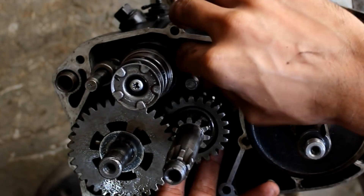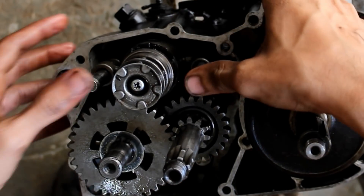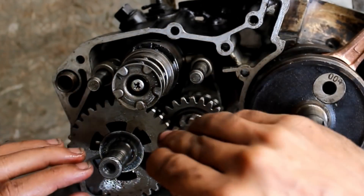To assemble the cam, you have to remove the guide bars from their position and set them aside so that the cam can go in. There are three tracks on the cam — the middle one is for the fourth gear, which is for the right shift fork, and the remaining two are for the first, second, and third gear, which is for the left two shift forks. Insert the shift forks in their respective tracks. After assembly, check all the gears by rotating the cam and make sure everything works fine.